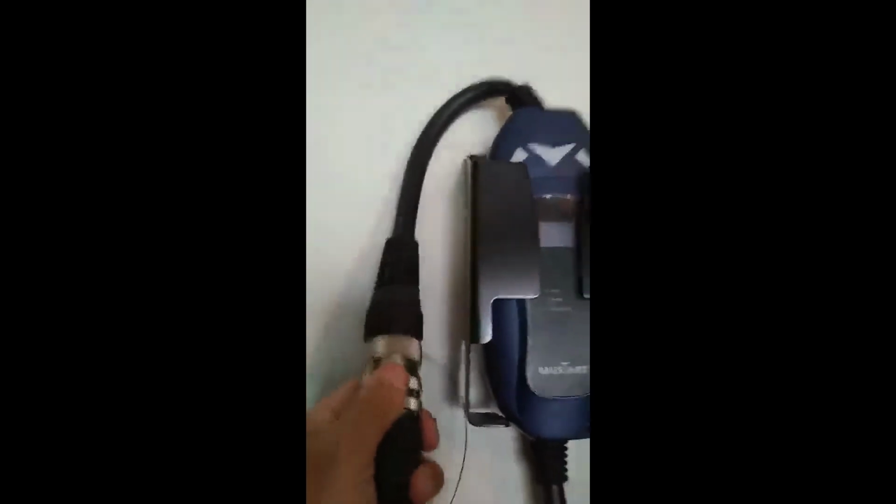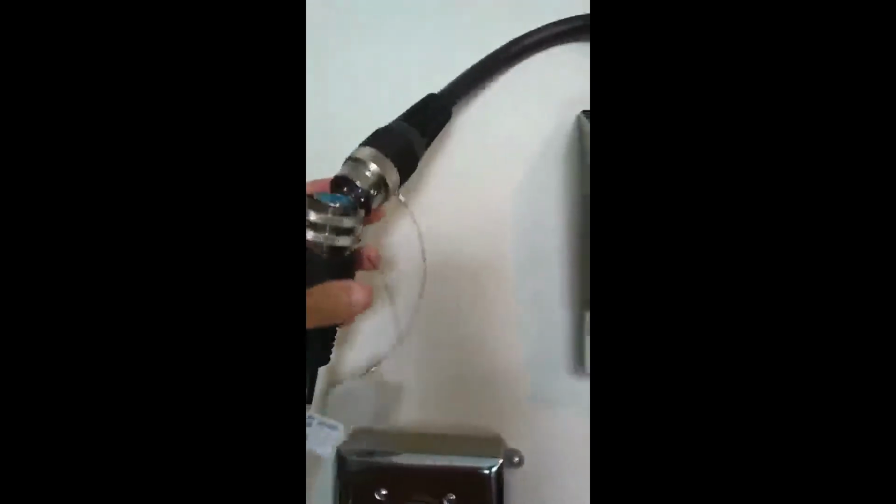You can come up here, disconnect that plug, and connect a different one. I'm going to take this regular plug right here that would work on pretty much any type of connection. I'm going to connect it together, and it's pretty easy to do. It's just a snap-together connection. Come down here, I'm going to plug it in, and now we're plugged in again, but you'll notice that it's no longer at 32 amps, now we're at 15 amps, and we're charging at 114, 116 volts, whatever the case might be.